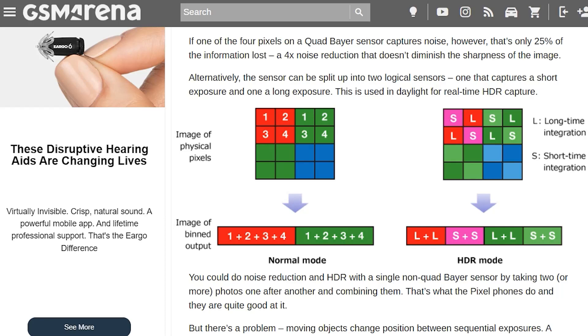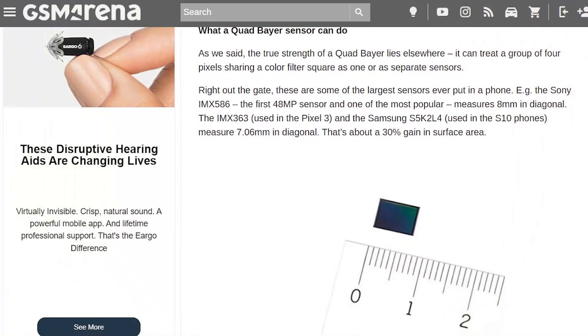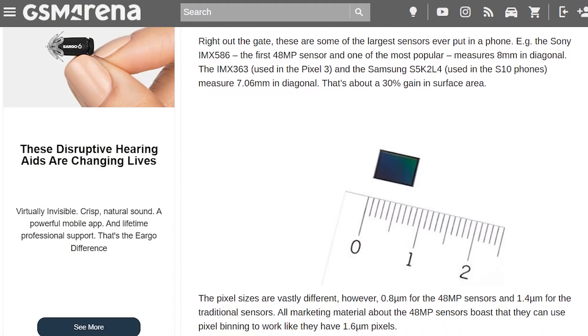The problem is these actual sensors — the pixel sizes of these smartphone cameras — have typically a half inch sensor, and that's being very generous; it's usually a little bit smaller than that. That's not very big. So the pixels on the inside of that sensor, they're going to be really small. Just think how much light can you really capture on a half inch of surface space? It's not a lot. So you're going to see the manufacturers trying to do whatever they can to boost up the pixel density on these images to try to capture more for those low light scenarios — hence why we have the quad Bayer and the pixel binning.